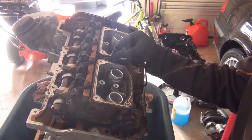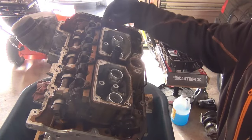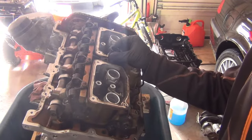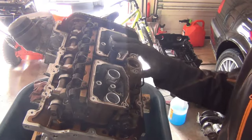This component right here is the eccentric shaft motor, and it drives via this helical cut gear — it drives the eccentric shaft. This motor does sometimes go bad. It can pull down the 5-volt sensor system, and when that happens you can end up with a bunch of different faults.